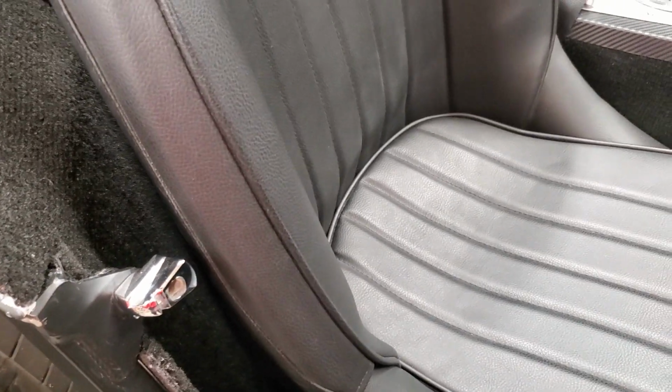Wanted something that was going to basically provide some sturdiness to it. It does actually provide a little bit of bounce too. There's enough flex in that 4-inch flat bar off from where it's bolted to the C-channel that it'll actually provide a little bit of flex. So it's not super rigid, but it seems to work.